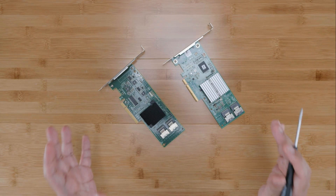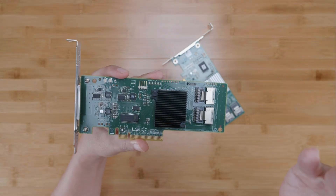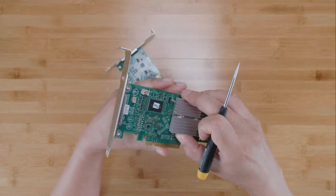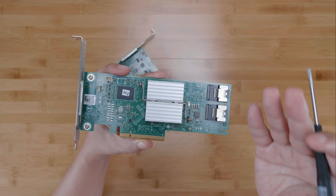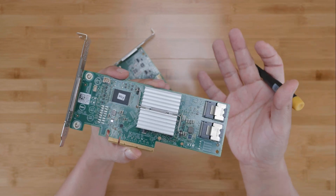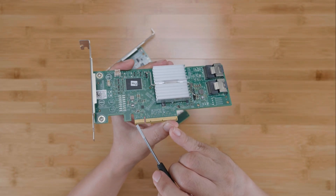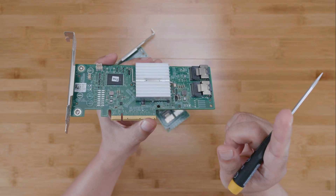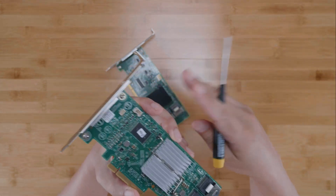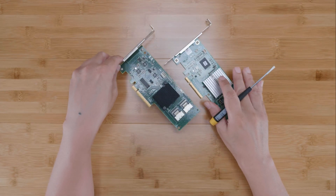Second, the LSI controllers have no SMBUS signal and provide the broadest compatibility. The Dell H310 has Dell's custom SMBUS signal that works with Dell servers. This SMBUS signal can sometimes cause a conflict with some motherboards that use the SMBUS in their own way, resulting in a system that won't POST or perhaps disables some DIMM slots. You can work around it by covering the SMBUS pins on the PCI connector with tape — I'll link that video for you. I find this conflict happens most often with Gigabyte motherboards and HP computers. If you just don't want to deal with this problem at all, the LSI controller is your choice.